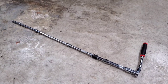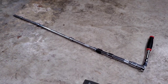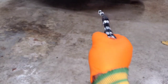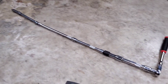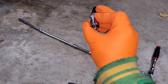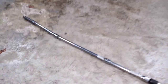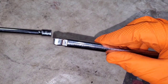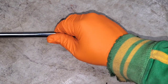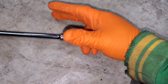Here's my extension setup to get around the bell housing to those top bolts — obviously those are the hardest to reach. The transmission is about two and a half feet long, so all these extensions with an E14 at the end are about three feet long, and I can get it almost straight and aim right at a bolt. A lot of people recommend wobble joints for getting around corners, but when you're trying to aim, they just flop down and it's really hard to get on the bolt.